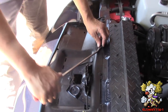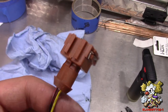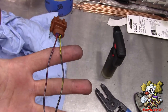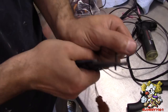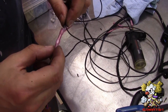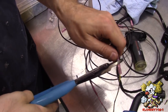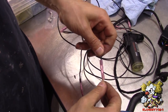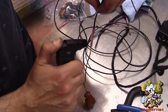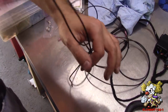We're going to start the wiring now, just going to pop this cover off. This is a third gen Camaro we're working on. We have to extend these wires - I'm going to cut these, put some butt connectors on them and extend them about a foot or so. Strip this, twist it, stick it in, crimp it, give it a little tug to make sure it's good and heat shrink it down. I already did both sides.